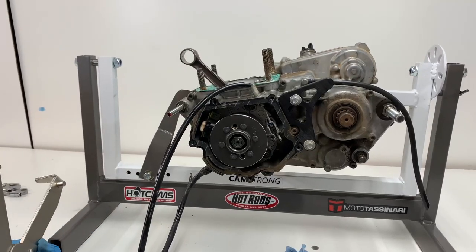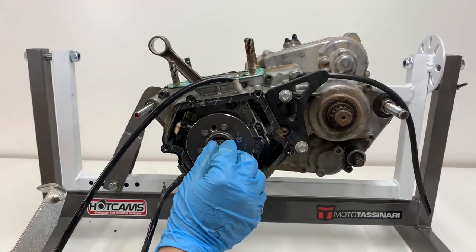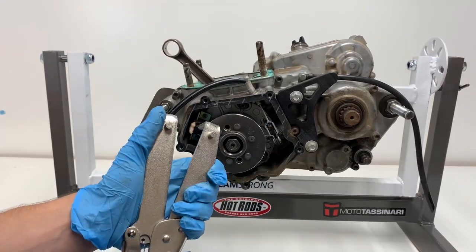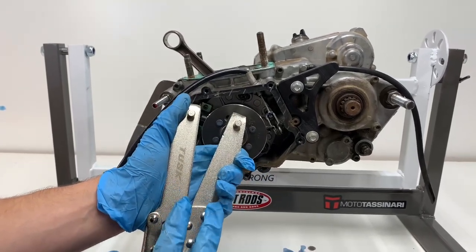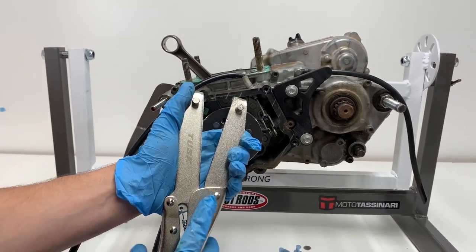Alright guys, now I'm going to go ahead and remove the flywheel here. I'm going to use an impact to take off this bolt, but I'm going to lock up the flywheel just with this clutch holding tool from Tusk. This also holds a clutch basket. You'll see me use it again on the other side of the engine, but I'll put this down in the description for you guys. It's super handy when rebuilding your engine.